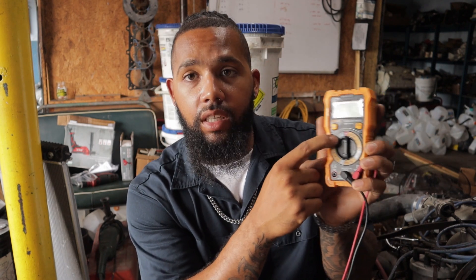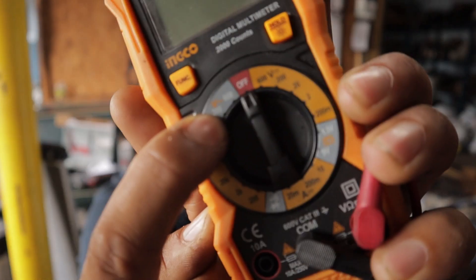Today it's super simple. You get your car running, start it up, set your multimeter to the V with the wavy line, which means AC current. Take your positive lead and put it on top of the positive big lead on the alternator, take your negative and put it only to your battery ground — that's how you get the proper reading. You should get 0.5V at most of AC ripple. Anything above that you're going to have issues with your sensors and you need to take your alternator in to be checked.